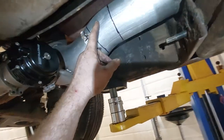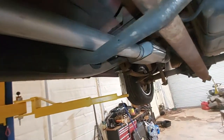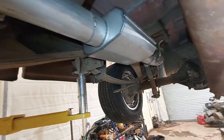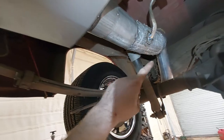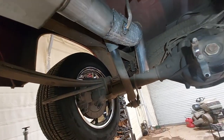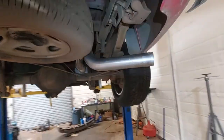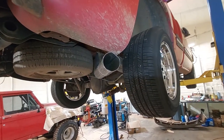It comes back up, rises, and then comes over back to a four-inch Hooker Max Flow, then offsets. I cut, rotated, and added this piece to make this tailpipe work, so it comes all the way out the back on the side. It got a little damaged in shipping so I'll get my ball peen and clean that up.